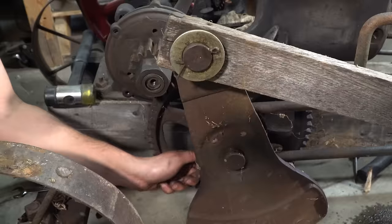The ring must spin freely even though it locks into a position — we can't have air flowing past it. Looking at the rest of the piston, I notice chunks of Babbitt coming off. It looks like whoever previously poured the Babbitt scored the oil holes too deep and actually cracked it. They may have used the wrong type of Babbitt — tin-based Babbitt, rather than lead-based, is better for higher-speed, higher-impact applications. There's also a Babbitt with more copper that's even more impact resistant. The tin-based one is probably optimal for this application given its ability to handle higher speeds, so I'll have to purchase some of that high-speed Babbitt.